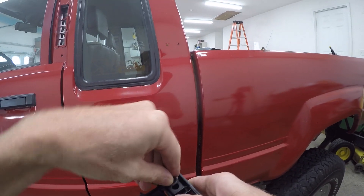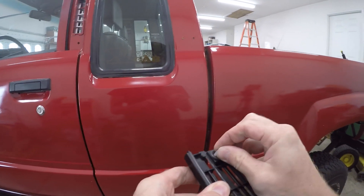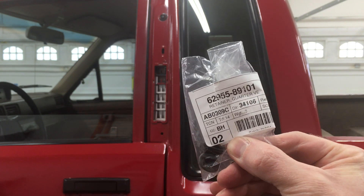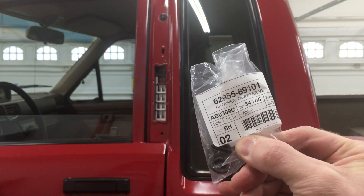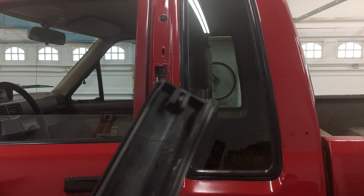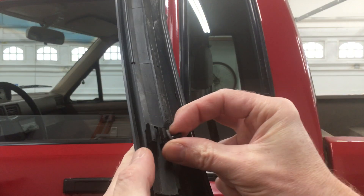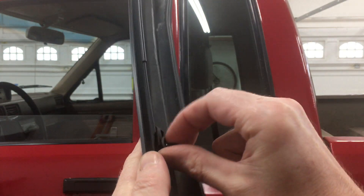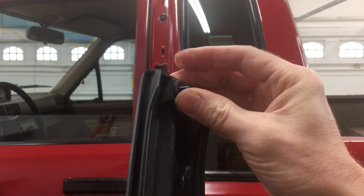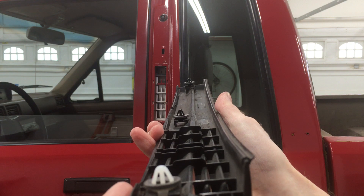I'm just going to slide the bottom clip in. You can turn it 90 degrees — nice and tight. Here are the clips for the middle and top, different part number. I'll put this one in the description as well so you can copy and paste it if you're ordering online. Remember, if you have a 4Runner, you'll need 4 of these for each side. Trucks just need 2 per side. Alright, I have the 3 clips and both rubber gaskets in place. Let's get this installed.